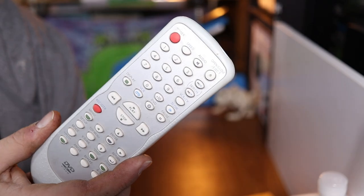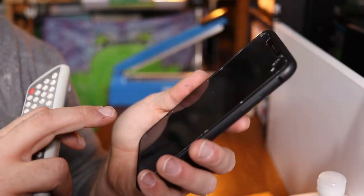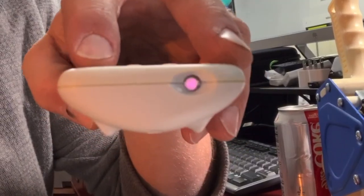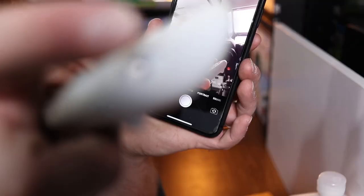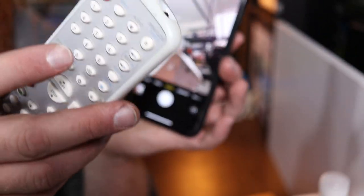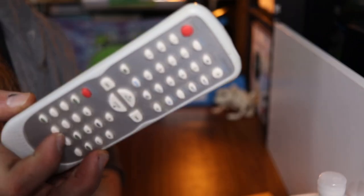There's no way to completely test it without having the component the remote belongs to, but one way to be 99% sure that it works is to use your smartphone selfie cam. All you do is turn it to selfie cam and with the batteries loaded, start pressing buttons on the remote. If you see bright flashes of light coming from the sensor at the bottom, you can be 99% sure that this remote works. It's a good idea to test every button, because sometimes most of them will work but you'll find one or two that don't — and that remote probably isn't functioning 100% and therefore not a good buy for resale.